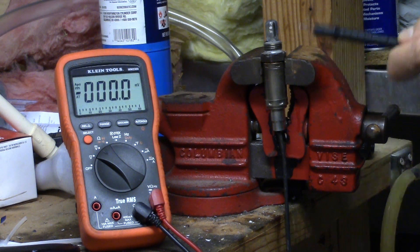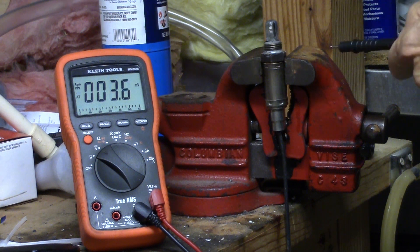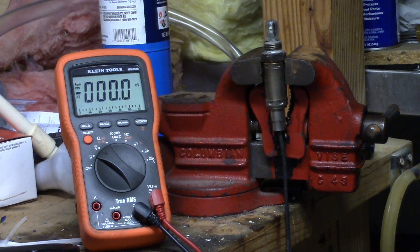This brand-new sensor is defective. I had put the old sensor back in the car because it tested good, and the car now goes into closed loop, it's running a lot better, and it's cleared the code — life seems better. The only downside with the original sensor is it's a little slow to heat up, and sometimes it won't stay in closed loop at idle where the new one did, at least until it went bad. So I'll probably need to get a fresh sensor, but it's an interesting test, and the fact that I could make that sensor fail on the bench was very interesting.